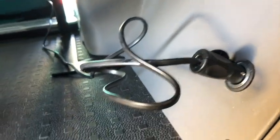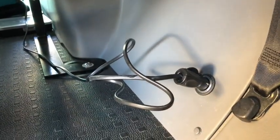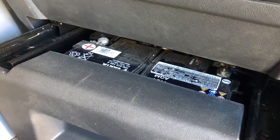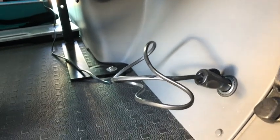If you want, you can just plug in the power cord — this is your power cord — into the 12-volt socket situated just underneath the rear seat. Or you can run a cable straight underneath here into your leisure battery that you can fit under the driver's seat. But if you're keeping it simple, you can simply plug it in here, and this powers the lights and the water pump for the sink.